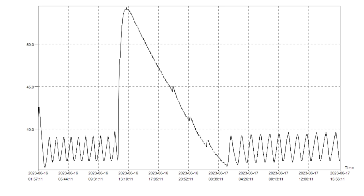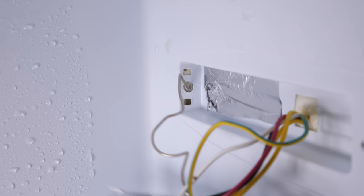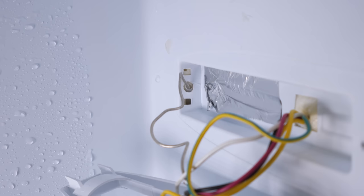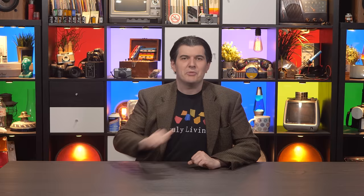It's honestly less significant than I thought it would be with 4.5 gallons of water in there, but the triangular shape is a bit wider full versus empty. In numbers terms, empty the fridge ran for 25 minutes then spent 33 minutes off, and full it ran for 33 minutes and spent 37 minutes off. Those numbers probably aren't exact because of the data fuzziness, but it's definitely noticeable. And by the way, there's no reason the fridge has to have an electronic thermostat to work properly. With how cheap microcontrollers are these days, I'm somewhat surprised this was built with a mechanical thermostat, but its mechanicalness wasn't ever the issue. It's where they put the dang sensing bulb and how they ran the capillary tube to it. If it actually measured the air temperature inside the fridge, that'd be fine, but instead they buried it deep within the walls for some unknown reason and made a weirdly bad fridge as a result.